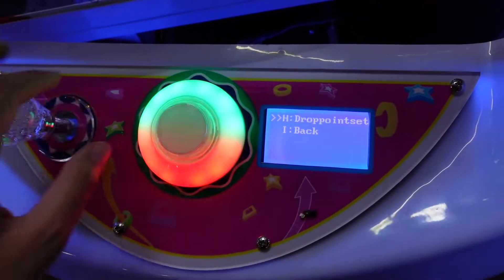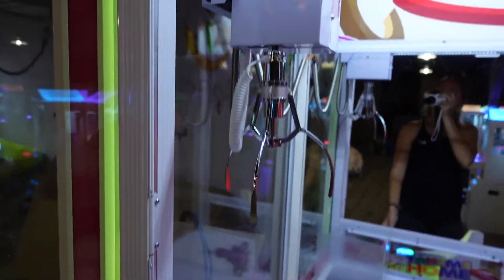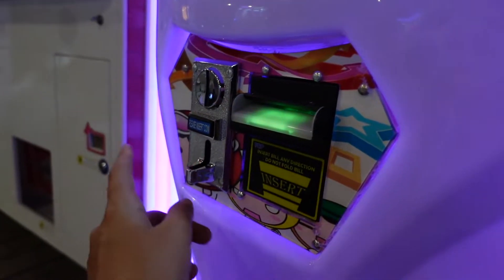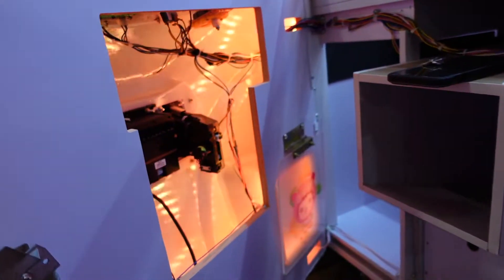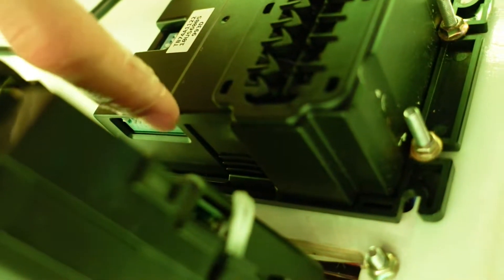For everything else, that's pretty much it. We just go out, hit back, and it takes us to the playing mode. That was the red button — now the yellow button will add you credits. So now we have credits to play. That's still really, really strong — that's pretty much how you set it up. Then it comes down to the bill acceptors and the coin mech. These you have to change for U.S. currency. For the bill acceptor, you have to flip these little switches on the side. You switch number one on and number five on. So I've flipped the one and the five on — this bill acceptor is good to go.